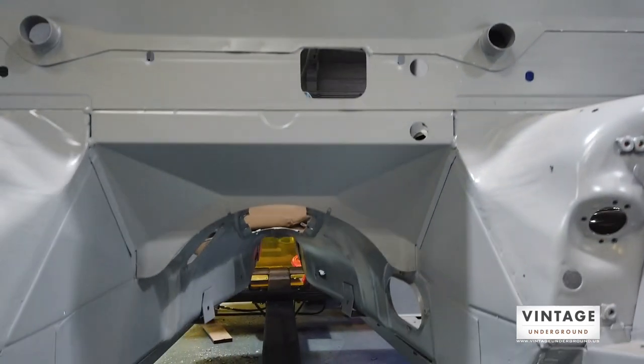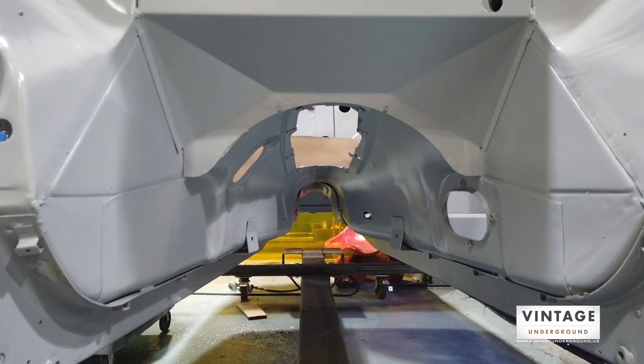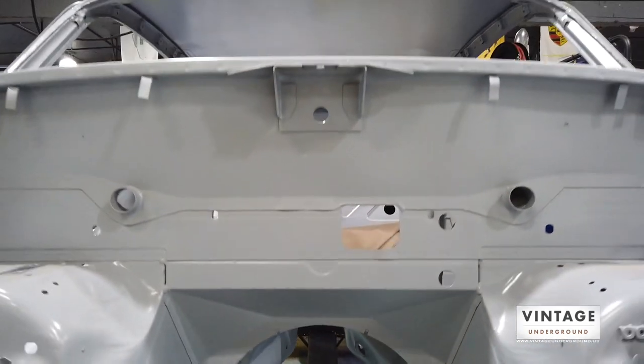The transmission I still have to fit. I don't think it's going to be a colossal problem because the automatics that were in these cars were rather large and there's already a pretty good-sized tunnel. I don't think I'll have to enlarge the tunnel — might be a couple of massage moments — but I can see the tunnel here and it's a pretty good chunk of room. I need to confirm where the shifter lands, but I think I've got it mapped out. I'll get the engine and transmission in here at some point.